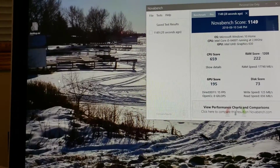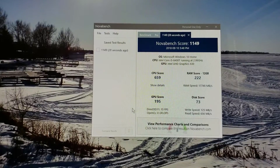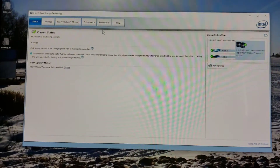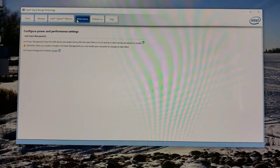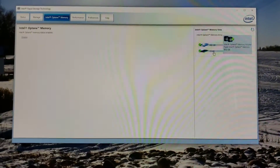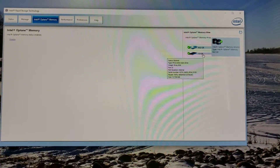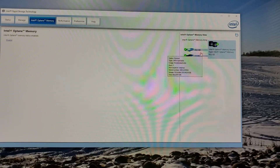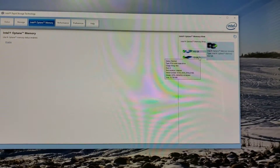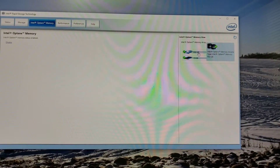I'm going to show you Optane. It's handled under Intel Rapid Storage Technology, so let's go take a look. You'll see that it runs just as a single disk. Under Performance, under Optane Memory, you can see its status is enabled and it's running. It's taking a whopping 13 gigs of the 16 gigs that's there, and it's combining it with a terabyte, figuring out, as we speak, what needs to be moved onto the SSD.